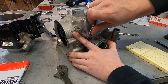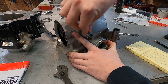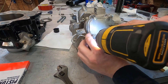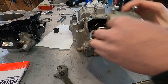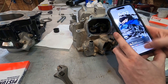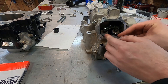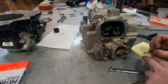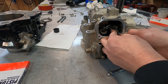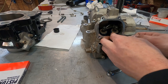I'm pretty sure there's an actual torque spec that these are supposed to get, but I think it is just a bolt spec rather than a seal spec because there's some nice O-rings on the inside of there. I'll pop this guy off and see what we have for our exhaust side — looks like a little bit bigger of a gap. Let's check: that is tight on seven, so it's left zero-zero-seven. Seven and a half does not go, seven does. So that looks good.